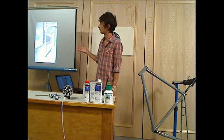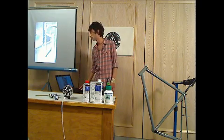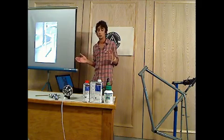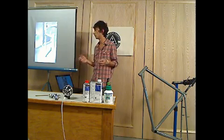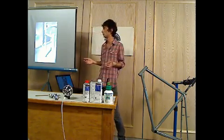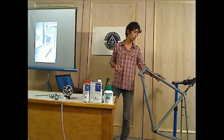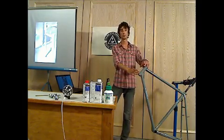We start with a bare steel frame. Start with the bare metal right after welding, and usually they clean it up with some kind of finishing techniques to deburr all the areas and whatnot. Just clean it up ready for paint. So I'll take it and prep it, basically, which just involves sanding down any little imperfections or raised portions in the steel, because we want to lay down a nice coat of primer